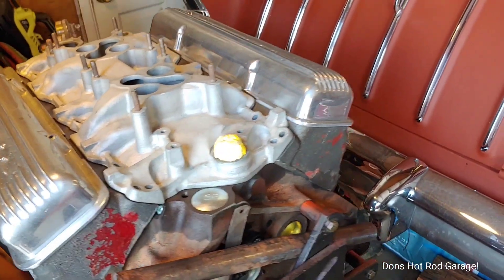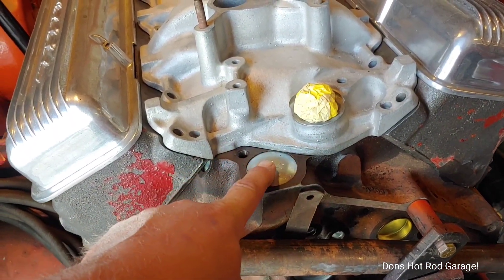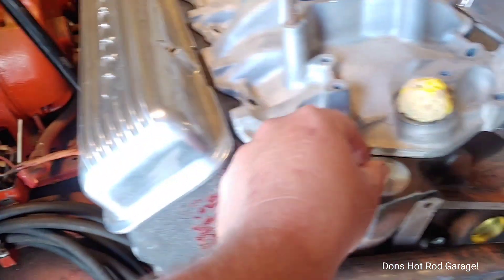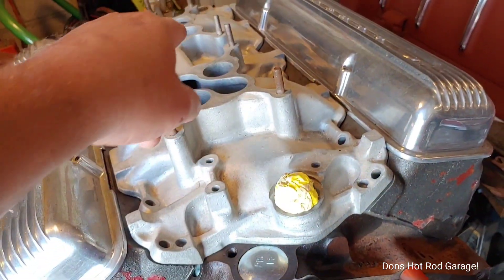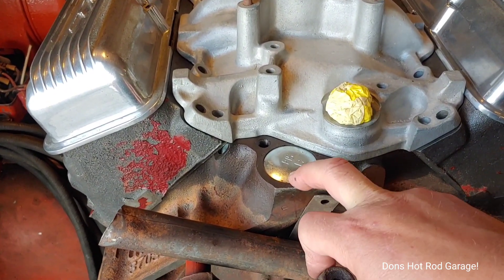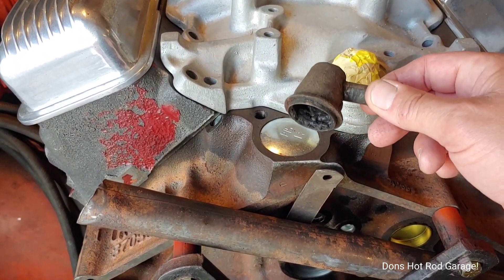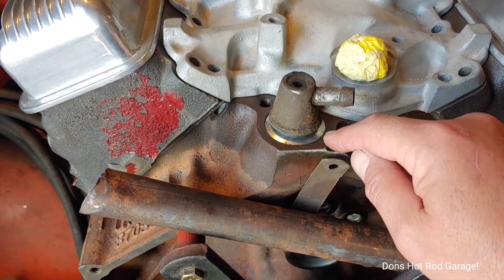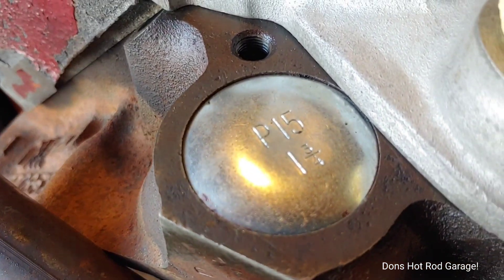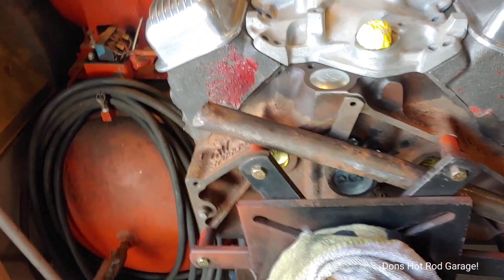See this — this is the plug I was talking about in my last video. Some people had a good idea where you could drill a hole into that and screw in a fitting to run it up to the carburetor and reburn it. But this plug right here is supposed to be in a '55 265 engine — look at the difference in diameter. This one will go right in a '56 Chevy block, but the '55 the diameter is way bigger. The only place I was able to find them was eBay — it's a one-and-three-quarters flat disc plug.